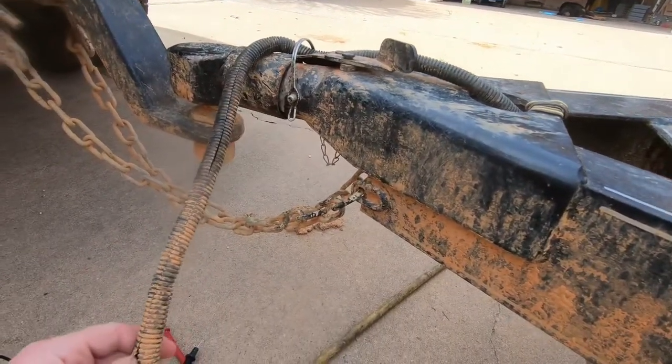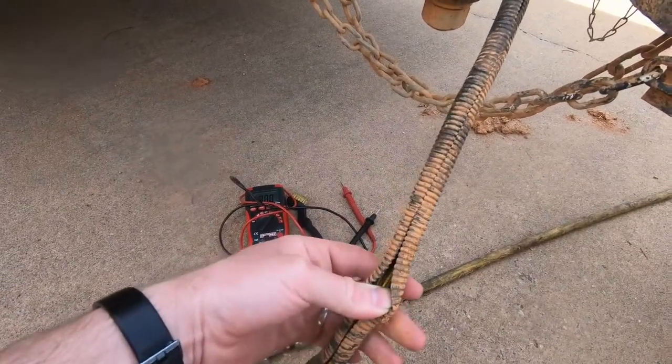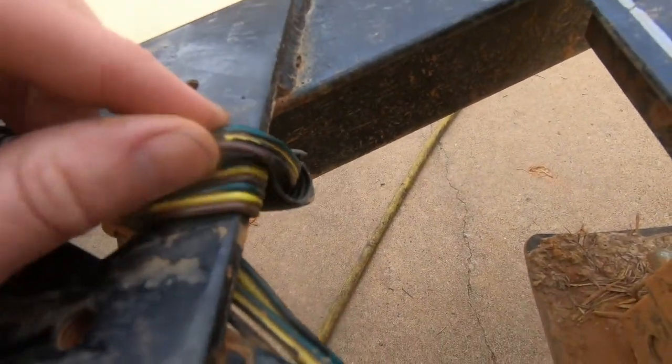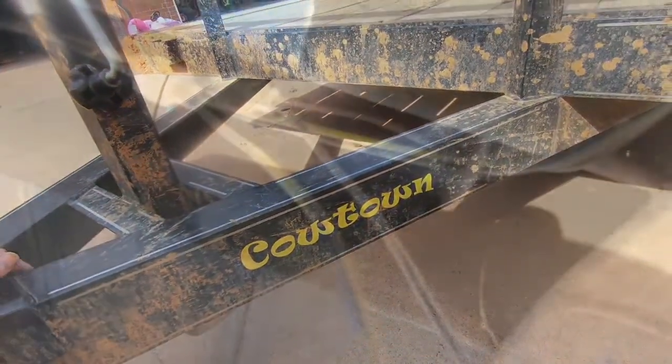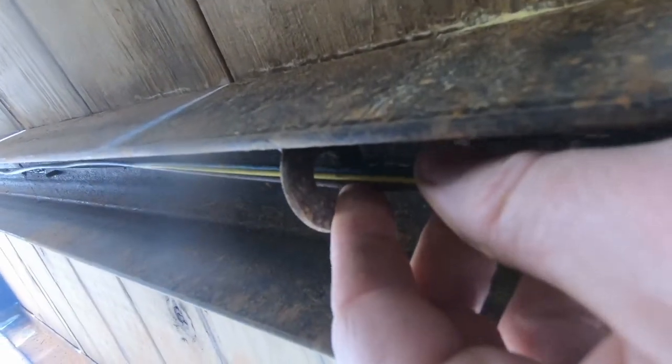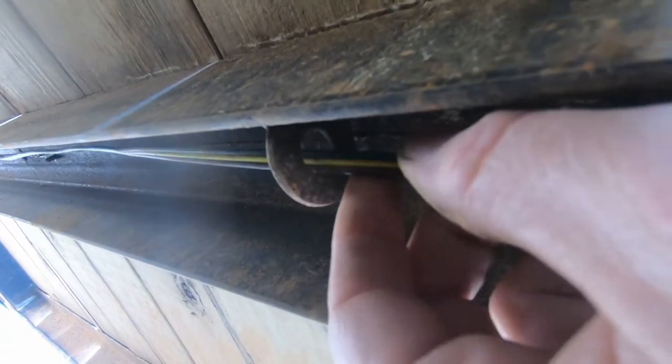So what I'm going to do is visually inspect the wiring up and down this trailer. I'm going to follow it and look for any spots where it's damaged, torn, or broken — anywhere that the brown wire might have rubbed through and be touching the frame, grounding it out. I'm checking the insulation everywhere there's a possible rub point. Right where the brown wire goes through that little holder, it has frayed and the metal is touching the frame. That is the short I've been looking for.